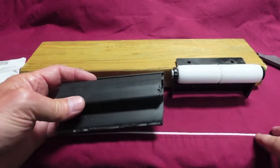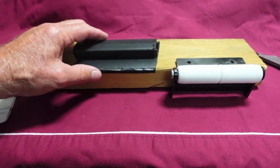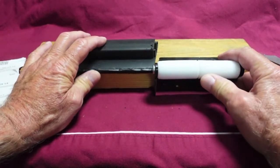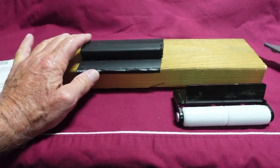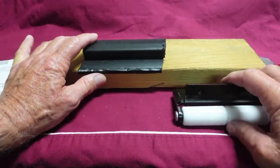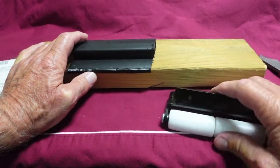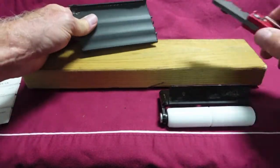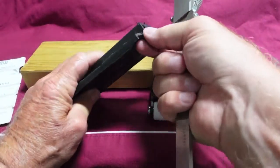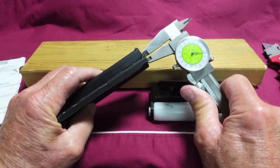So now's the time to do this. So by cutting this out, I'll take you out to the RV and I'll show you what we're dealing with. The only proper way to get this to be 3/4 inch is I would have to go in there and cut this whole strip out right here and eliminate it, because the 3/4 inch is from the top of the floor. The actual floor, the top of the surface where this underside is laying on. So if you measure the thickness of this, I thought it was 1/8. It's not. It's actually just a little bigger than a 1/16 inch.